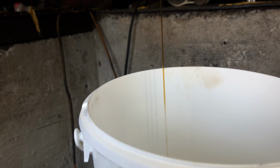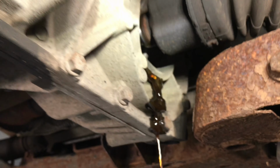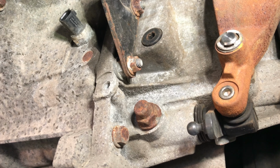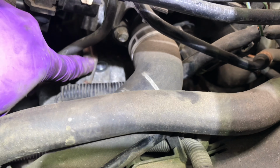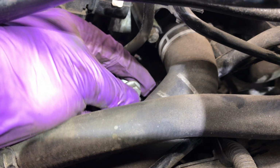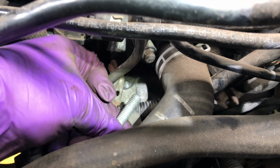We've popped the drive shaft and the oil just runs into one of the little buckets, because this one, as you can see, is the later version and does not have a drain plug. So this is actually better to do it this way, because we feel it's cleaner, because if you run it onto the front there, that plastic casing, oh what a mess. Far better. Problematic bolt to come out, this one just right here. So easiest way to get into it is to use a 13mm spanner and just open it up, and then it comes out by hand, no problem at all.